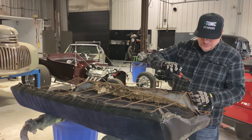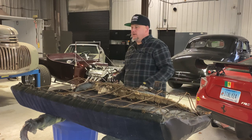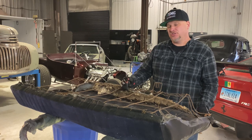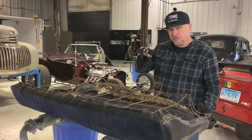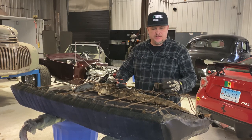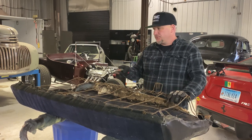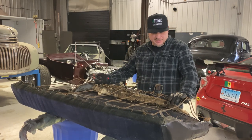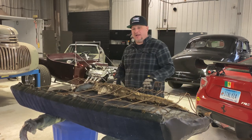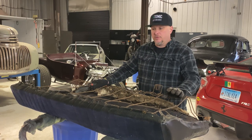One of the other reasons you want to wear gloves when tearing apart seats is not just because of the rust, but a lot of cars have super sharp metal, especially newer cars. Sheet metal is so sharp and jagged — when you stick your hand in to release a headrest or pull some clips off, you'll slice yourself almost every time. Also, whenever there's rat or mice stuff, you should probably wear a respirator. Some mice feces — the dust — can actually make you severely ill. Always be really careful around that.